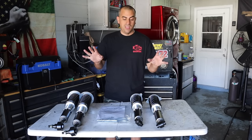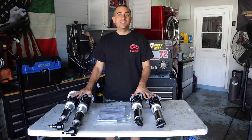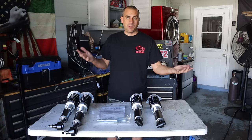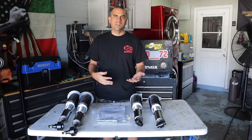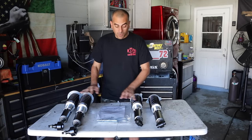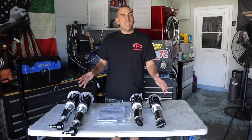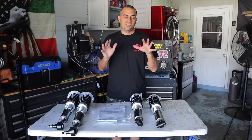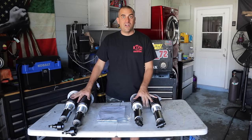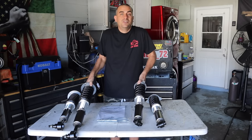There are quite a few things I did not like about the BC kit, and as I was looking over this kit it resolves some of those issues. With this kit, they say you do not need to buy sway bars. Some people go find an SL320 from Europe and buy their sway bars, which bolt right in, or they go to a couple of other companies that make them — Viking is one — but the sway bars cost about two grand more than this kit. This kit guarantees you will not need a sway bar. I don't run sway bars — I take them out of my SLK and a lot of my cars because they help when I launch, drop some weight, and I don't feel any difference in handling.